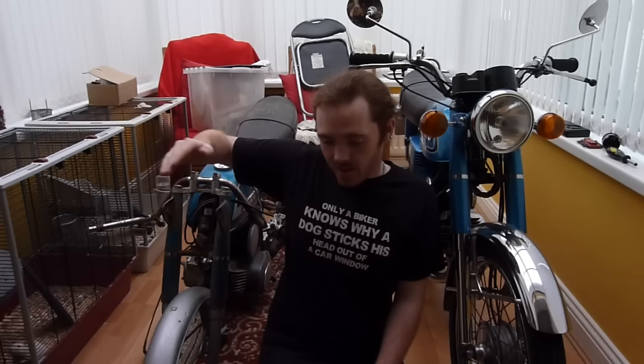In this video, as you can see, I've got an A100 to the left of me. I've also got an A100 to the right of me. Story is, this one's going to be used as a donor bike. I've been looking for a new cylinder for my A100 for quite a while now, because it's at its last rebore, and to be honest, it's rattling like a good one and it needs doing again, but I can't rebore it anymore, so I either get a new cylinder or I get it re-sleeved, which both are quite pricey.